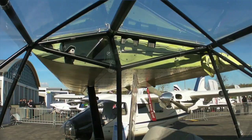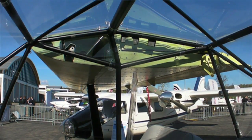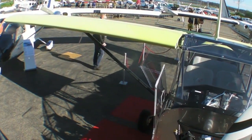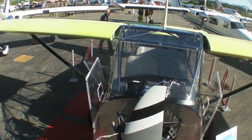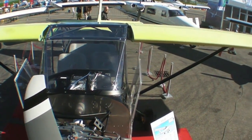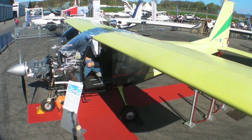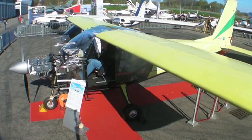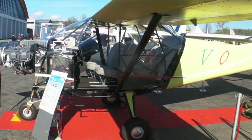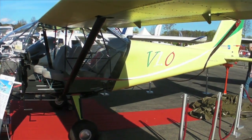The idea is to have a mechanically sound, conventional aircraft. We have a welded steel cage that protects the passengers and the pilots. The wing is aluminum riveted — we only use strap riveting, so it's aeronautical standard components. We have a steel landing gear that can be abused. And it's a relatively roomy aircraft — I'm six feet and I can stand under the wing. It's a big airplane for what it is.